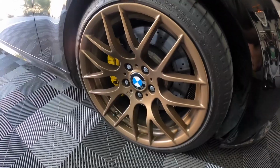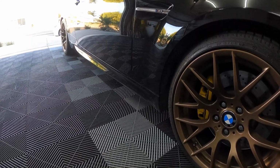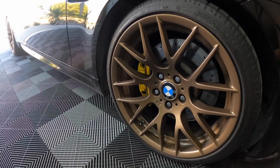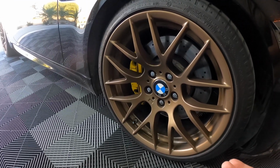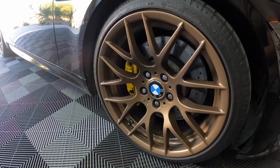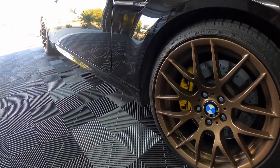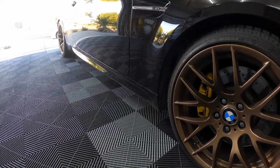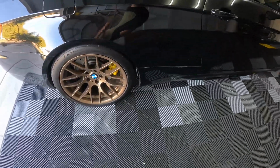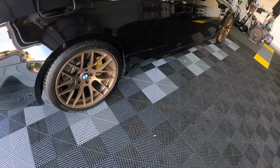brake pad sensors. I actually commented on Fresh Kick's video a while back, and he was kind of annoyed that I even commented about the brake light. Because I was watching Noor Humadi, and he had the brake light stuck on his dash, even though his brakes were fine, and it ended up being the clock spring. So I told Fresh Kicks, yo dude, it might be your clock spring, because he had just changed his paddles. I know you don't necessarily touch the clock spring, but BMWs are so touchy. I wouldn't be surprised if you change your paddle shifters and the clock spring goes bad. But anyways, because I saw his video, I now know I just need to change my brake pad sensors.